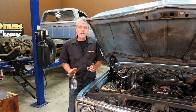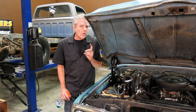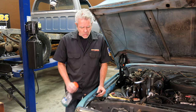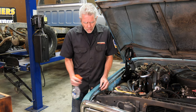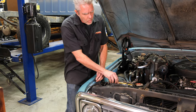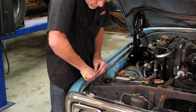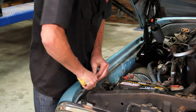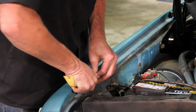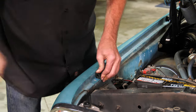The hood is on and lined up, but it's not done quite yet. We need to replace these little rubber stops right here. We don't want to do the lineup with them in because they can force the hood to one way or the other. Getting these in is a little bit of a trick — get either some soapy water or some Windex on there, put it at about a 45-degree angle into the slot, get something to shove it up in there, slide it up, and then on the very last bit hanging out, gently tuck that into the hole.